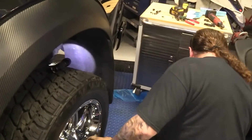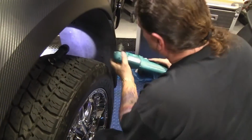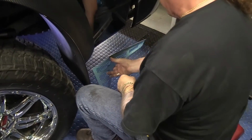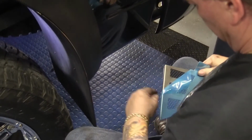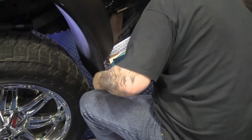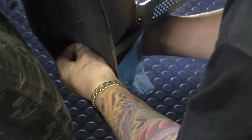Once you have everything tightened up, you can go ahead and just, all lined up, and just go ahead and tighten everything. Okay. Now that mudguard is really attached to the body. This goes in exactly the same as the front, so we'll go ahead and thumb those screws in with the 2 remaining clip nuts. Now these, you just go ahead and tighten up.